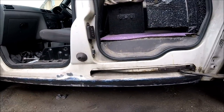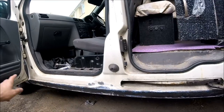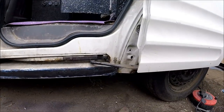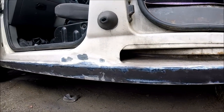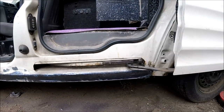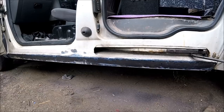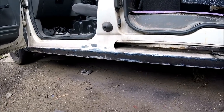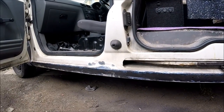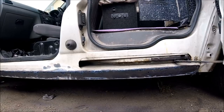I've just finished treating the passenger side with the Kurust as well — I didn't bother filming that as it's exactly the same: wiping off the Rustins rust remover with white spirits first, and then applying the Kurust quite liberally. As you can see, it's turning the metal a bluey-black tinge colour, which just means it's reacting with any residual rust pitting still within the metalwork. Now this just needs two to three hours to finish curing, then I'll be ready to apply some primer or stone chip, or a bit of both — maybe some red oxide then some stone chip — trying to get this as protected as possible.